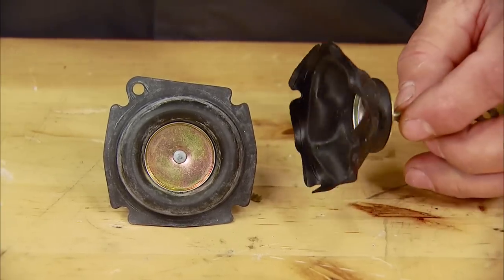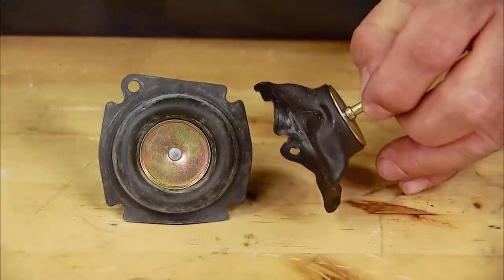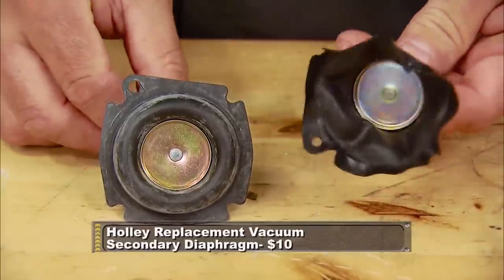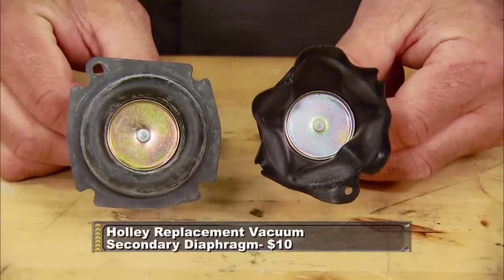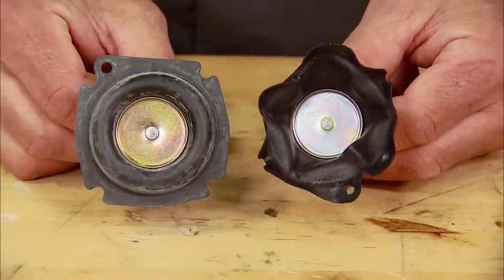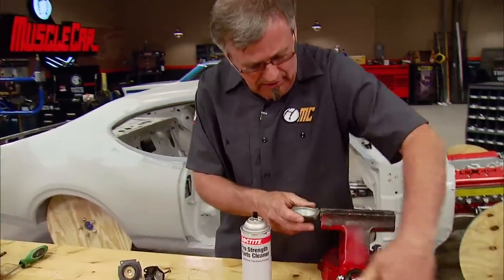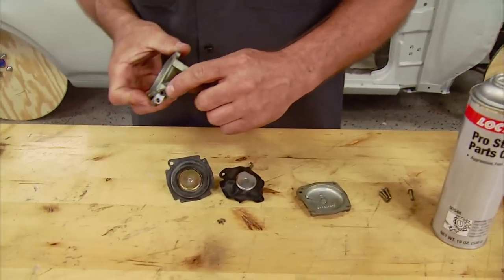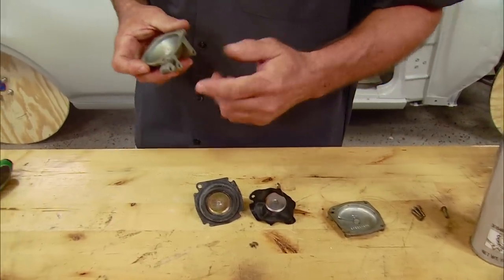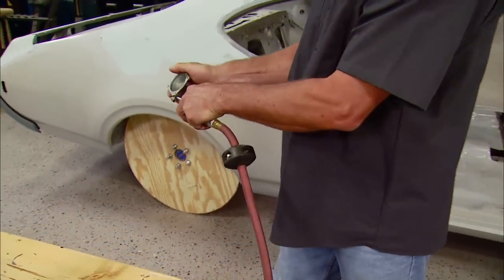As we mentioned earlier, you can see that the contamination has definitely gotten to the back side of this old diaphragm. So we're going to go ahead and change it over with this new unit that we got from Holley, which is definitely going to make an improvement on this four barrel carburetor's performance. Before we put the diaphragm back in the housing, we want to make sure there's absolutely nothing lodging the vacuum port on the back side, which goes into the main body of the carburetor. All we're going to do is take some compressed air and make one little shot through the housing itself.